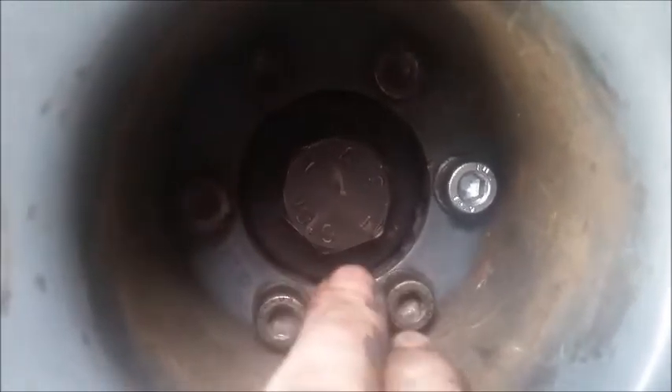I've got the balancer on, the other balancing plate, and the one for all the belts. On the inside there are six bolts that do it up, and the center one has three washers on it. Make sure the washers are all the correct way — they are one directional each. I've got to tighten it to 250 foot-pounds. I've put a red thread locker on there.